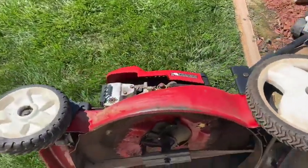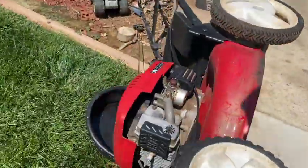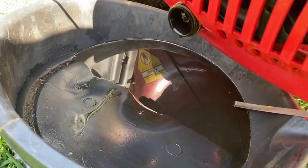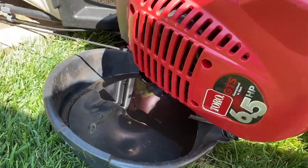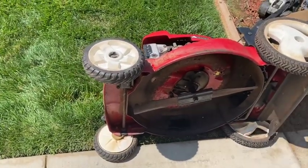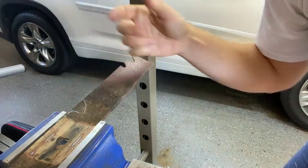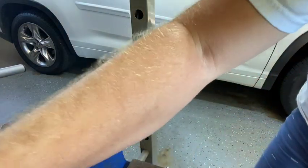All right, we're on our side. Here's the blade — I'm going to yank this off. The thing definitely needs sharpening, but otherwise I think the blade looks pretty good. We've got the oil draining right now, it's pretty close to done. I'll just tip the rest out — just your typical dirty oil. It looks really thin, so it makes me think maybe some gas got in or something. We're definitely going to change that out now that it's a runner. I'll put some new oil in there — don't put gas in there, put new oil in there. So it's not in the best condition, but I think I can get a little edge on it. Let me show you how to do that. I've got a Dremel with a little tip on it.